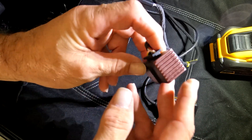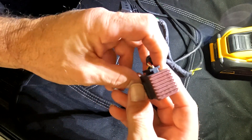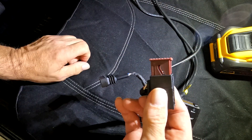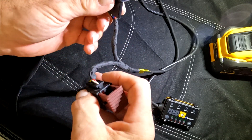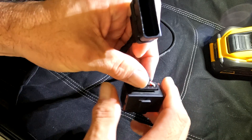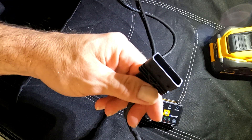When you look up under where your pedal is, you'll see a plug on top of it. The factory plug looks almost exactly like this. There's a plastic clip — pull that clip out with your fingers. The wiring harness will pop right up off the top of the pedal. You simply plug this piece back down on top of the pedal, lock it in place, and plug your factory harness into this end right here and you're done.